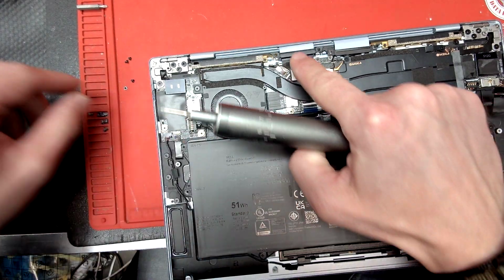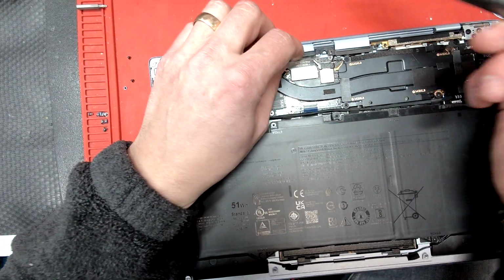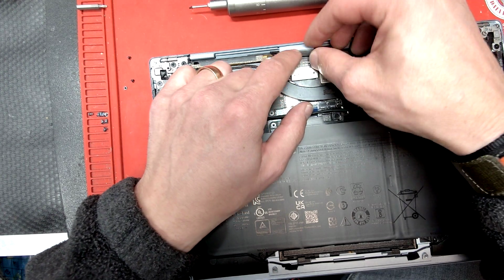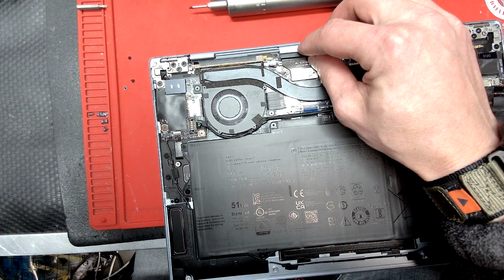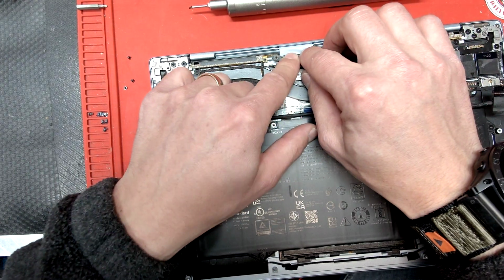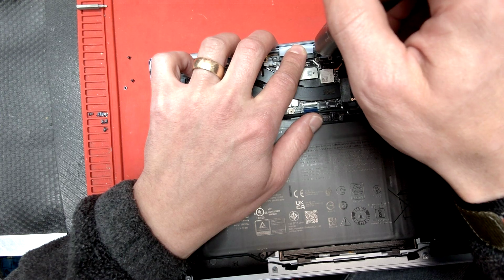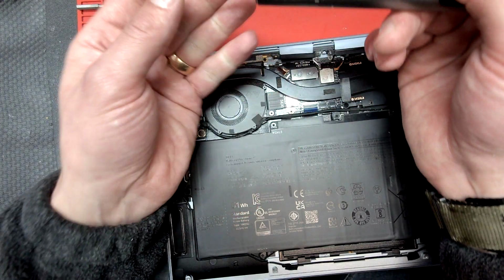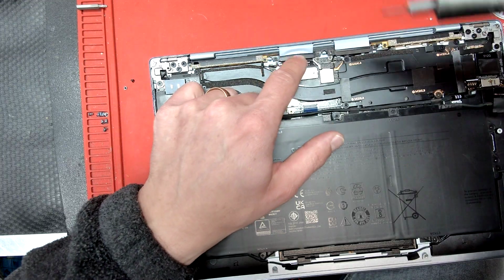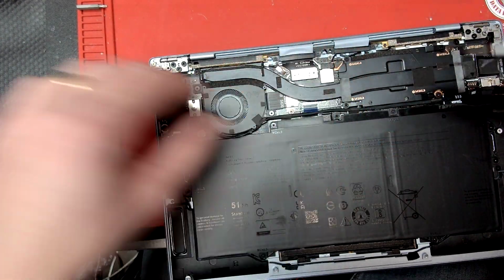That's that. Now we're gonna put the screws holding the cable. Let's see how this one goes. So yeah, that one would be bent, and this fella goes right on top. Okay, that will prevent the cable from actually flexing too much or rubbing when you open and close the screen. Okay, that's that, and we're gonna put this back right there.